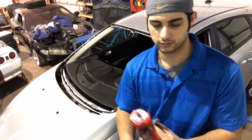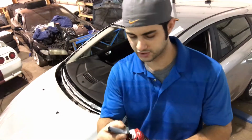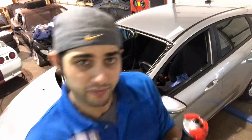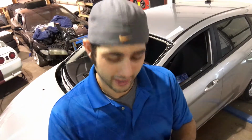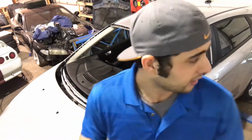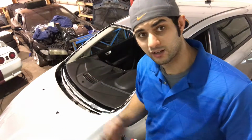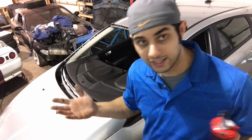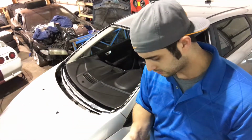So, like I said earlier, it's probably a tube and a bit. Now we got to finish the bit. So when you put the new tube on, squeeze a bit of it out before you put the cap on. That way you won't have an air bubble. Otherwise, if you just put the cap on and then squeeze it, you have a gap of air. And when you get air on there, you're not going to have a perfect bead. That could make a leak happen. It's not going to be right.